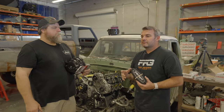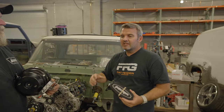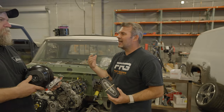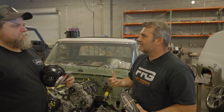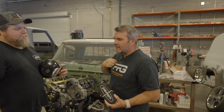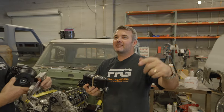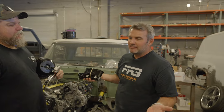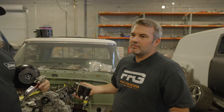You can also have garbage in your calipers. If you got new brake lines and forgot to clean out all the cuts and deburring debris, it's left in the line and ends up in the calipers. If that gets wedged in the caliper, those pistons aren't going to move nearly as easily. We learned this from an old system where a bunch of debris got pushed through into new calipers.